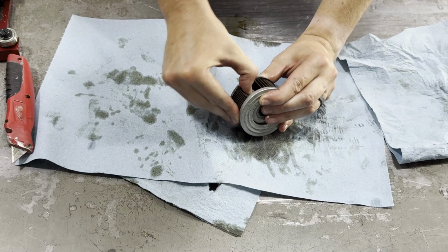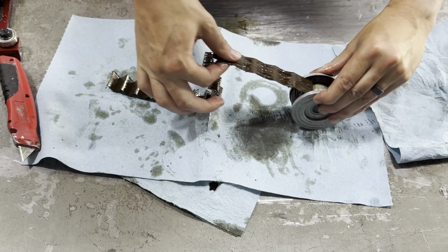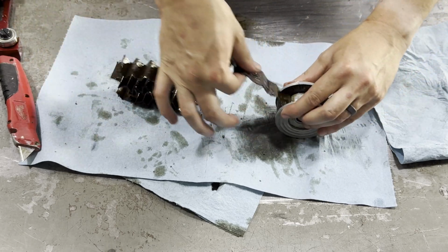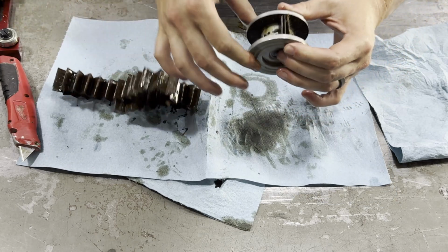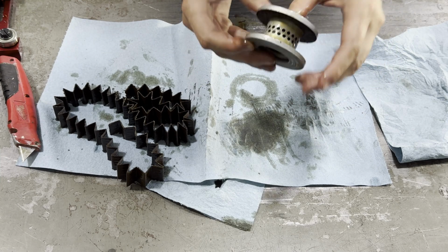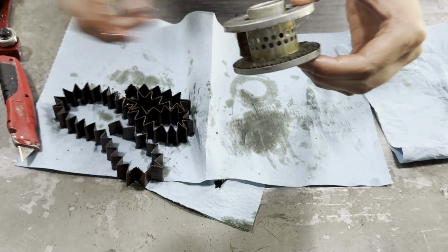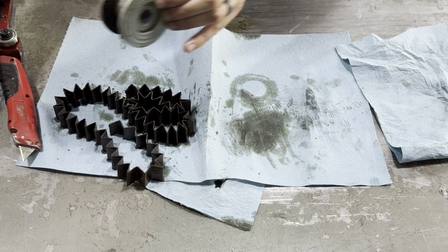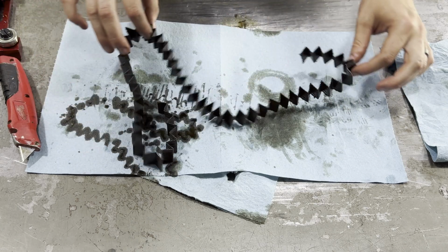So now that I've cut around all this material, we can go ahead and just pull it all out like that. That leaves us with the base cartridge, and you can see internal to here there's a spring inside of there. That's our pressure relief valve. This is just metal, it does zero filtration. This is our actual filter material.